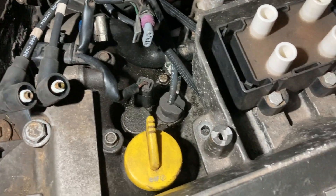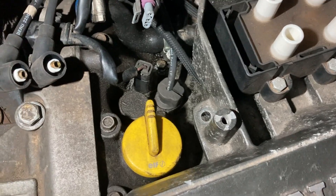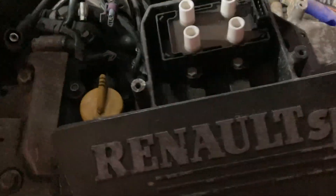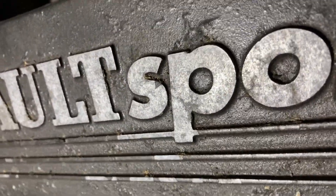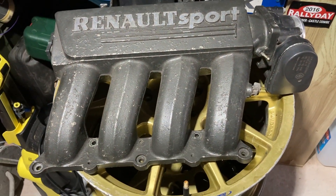The other thing to do is obviously to number the leads that are coming off — it's quite important to get the routing right. They are numbered on each lead, as you can see, but making sure they go back on in the same order, referring to the pattern of the coil pack, is also hugely important. The manifold should now come away from the head — I've just unplugged everything. There we go, job done. We'll give that a clean up and a lick of paint.